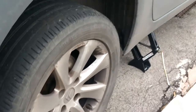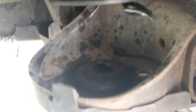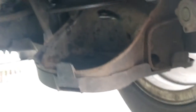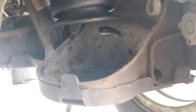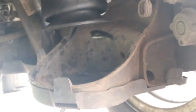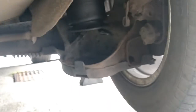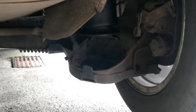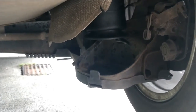So I have popped the wheel back on, and I'm going to slowly turn the jack down and then keep checking under here and line up that centre pin with the hole in there as it comes down. I could have done this with my Lexia software on my computer, because you can pump up individual wheels, but I appreciate not everybody has that. And equally, my computer is now, since I turned it on, updating Windows, and it's going to take hours and hours, so I'm not waiting that long. I'm just going to try and cheat. So let's see how far this comes down. It's going to go all squashy and flat. And then see if we can use the car compressor to pump it back up.